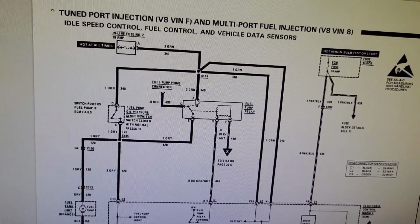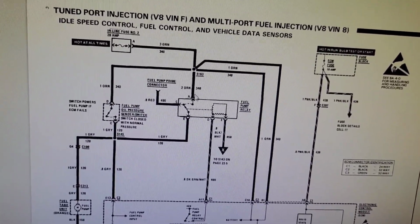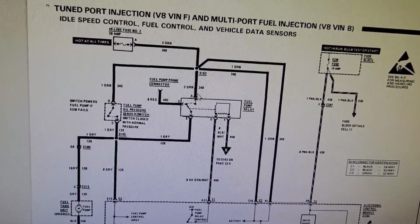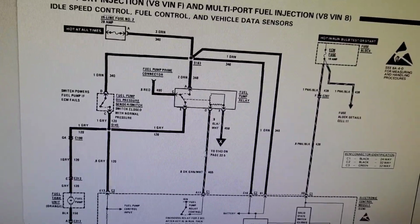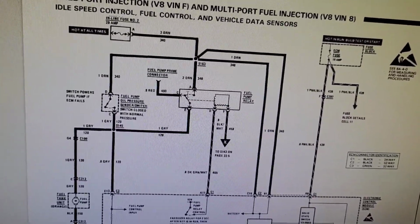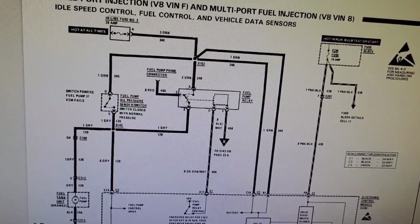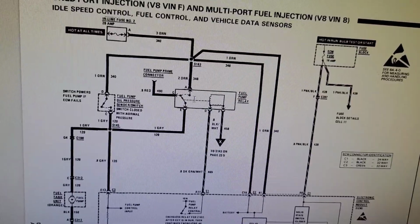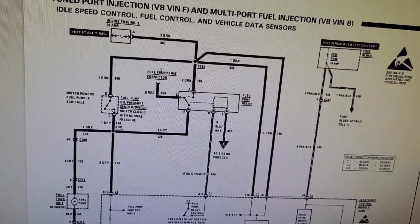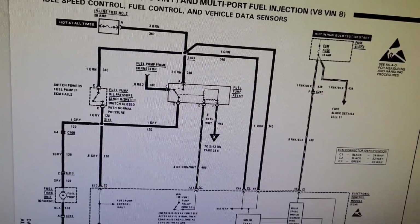What's important here is that on pin A of the relay, as soon as we have that battery hooked up, we have 12 volts there. It's ready to go. If you're not familiar with how a relay actually works, we have our coil side and we have our armature side. So this switch here, this is internal to the relay, this is the actual armature. In a normal condition without the coil being energized, pin C is, let's call it a completed path.